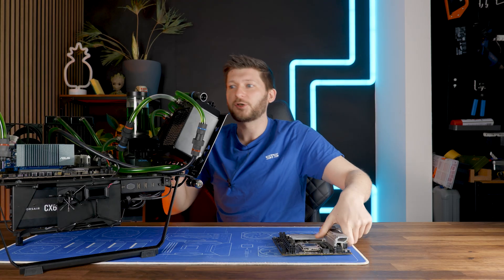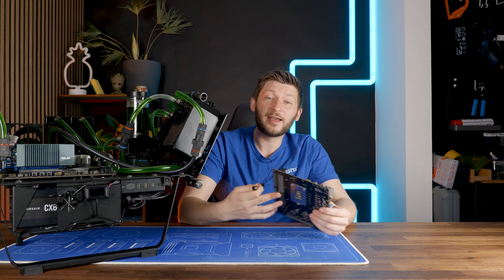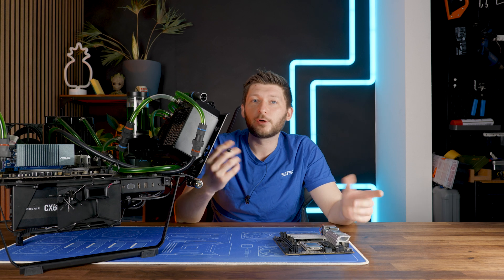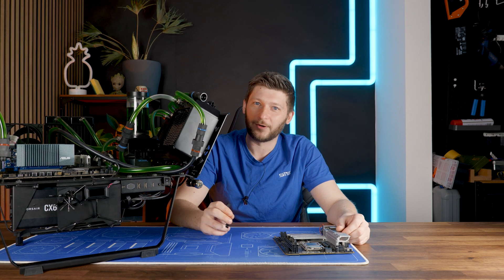I had no clue what was going on. And very fortunately, the next day when I returned I remembered that I have a bunch of these little speakers laying around that you can plug in. I found one of them, which was surprisingly hard, and I installed it on the Mini ITX motherboard. Unfortunately for myself, the beep code was five short ones, which in ASRock language is some sort of CPU error.